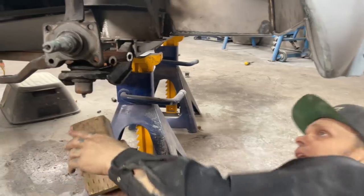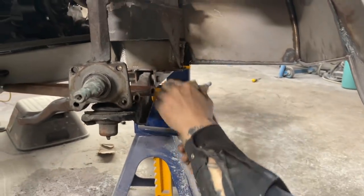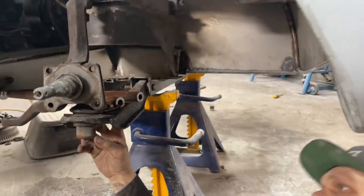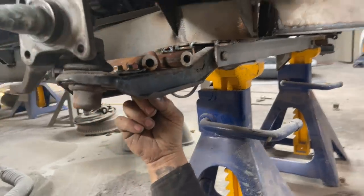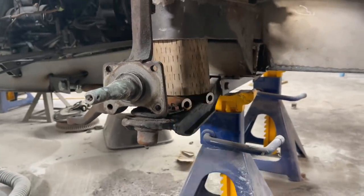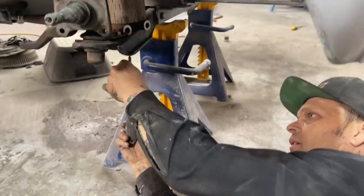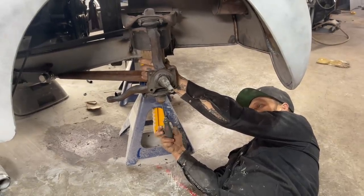I'm hoping I can just get it going plumb up and down. As I've got this piece of four by four, the airbag will go up inside of here and set on top of this radius arm. I'll put a pad there. There's a small hole there—that's where I'll put my bolt up through the hole, screw it up through the pad onto the airbag to hold it in place on top. Then I'll put a nut on top and that'll hold the bag in place.